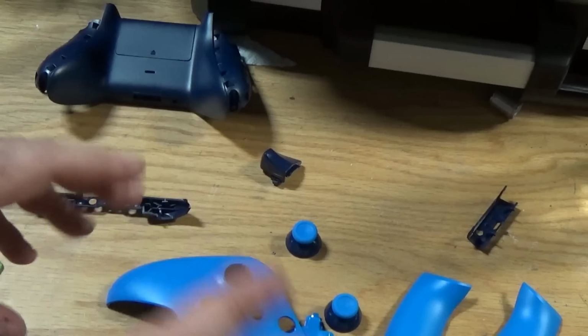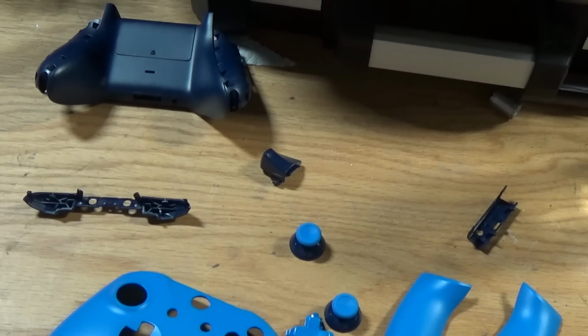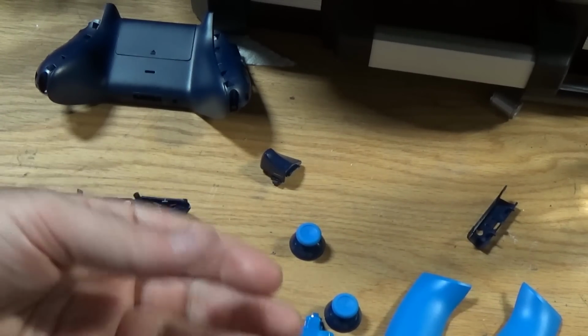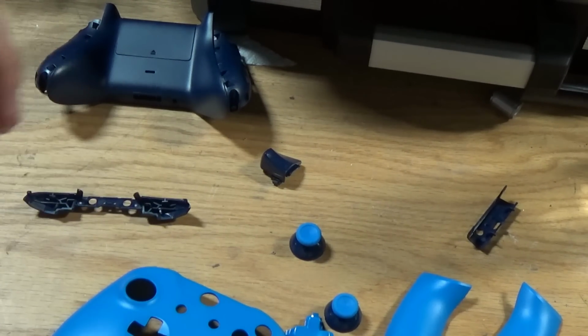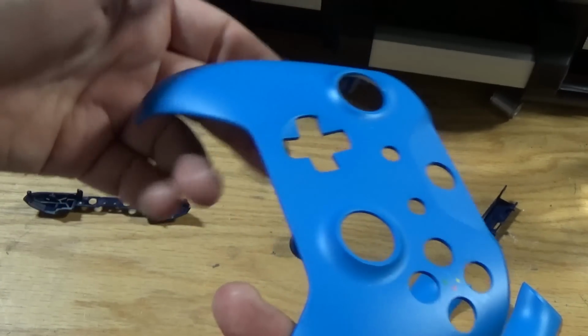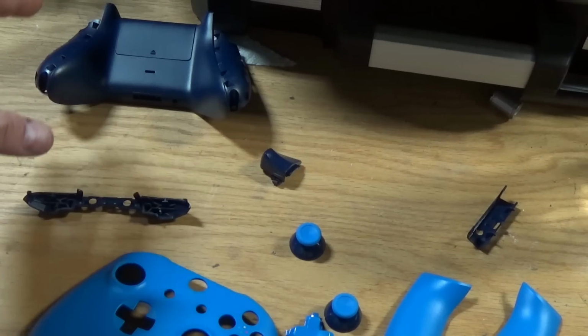There's stuff you've seen in other videos, possibly. We need to scuff it. We need to use wax and grease remover to make sure there's no oils or even fingerprint oil. No release agent that's maybe seeped into the plastic or any resins from the plastic production still in there. And then we can get to work on doing our base coat colors.